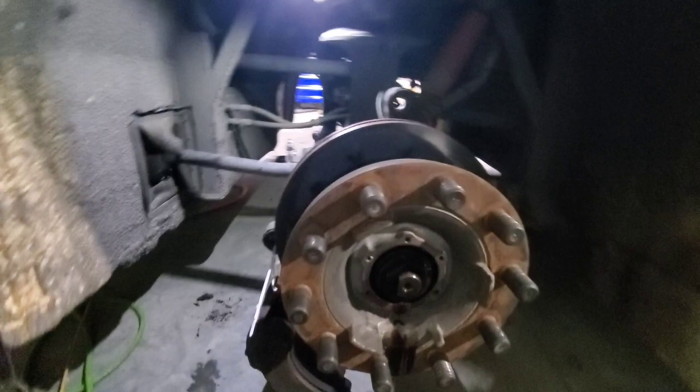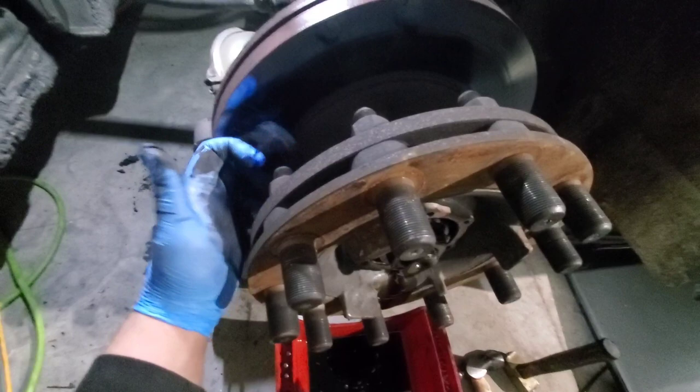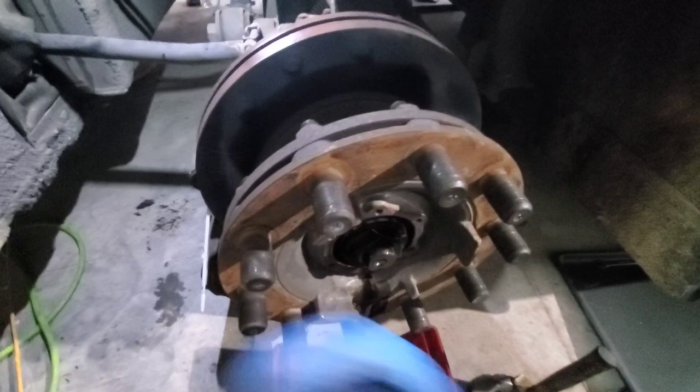I will show you guys that better when I'm reassembling it, but to get the rotors off on these you've got to take the hub off, which is pretty straightforward — then all these bolts come off and it lifts off that way. Now you're not going to fit a ratchet in here well; you might, but you generally run out of clearance before you get them all the way off. You might be able to get them loose with one, but I do find it's easier to just use a wrench on those.